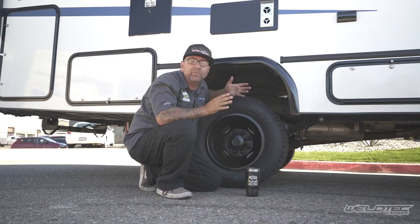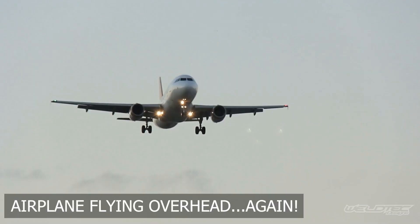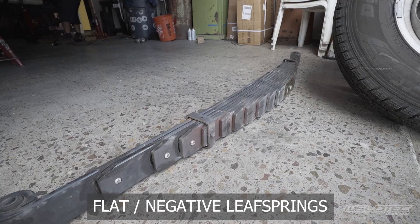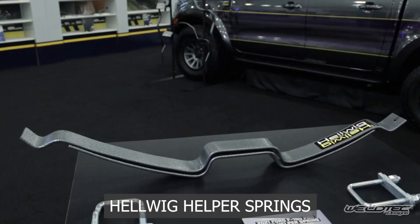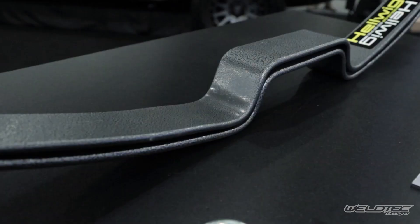Helicopters and airplanes flying over all the time — I guess that's what happens when you're in the path of an airport. You just got to roll with it. We have added our progressive leaf springs in the back of this. If you've seen any of these videos, you know that's really important because depending on the size of your RV, some of these RV leaf springs sit really flat. The larger your RV gets, the more band-aids they've installed to get it off the lot and help it carry the load. You'll see things like airbags in the rear and helper springs put in the back. The helper springs help carry the load of an overweighted RV.